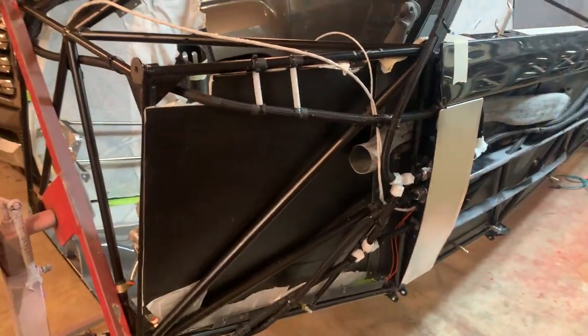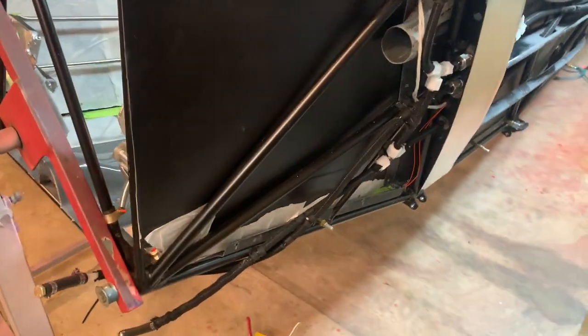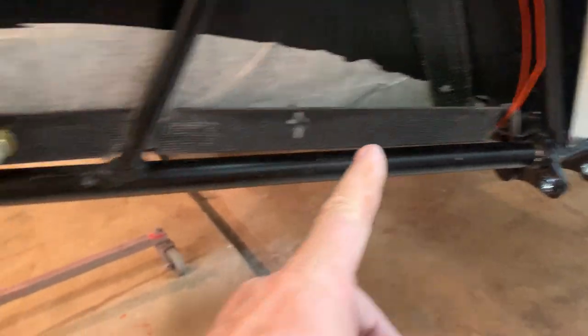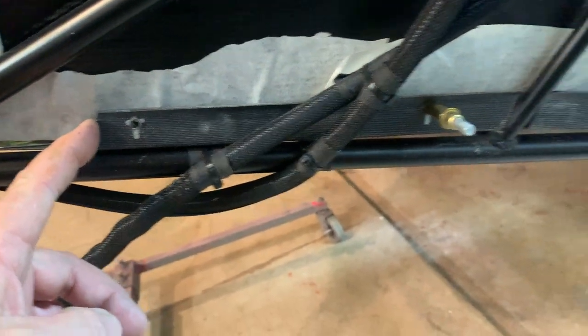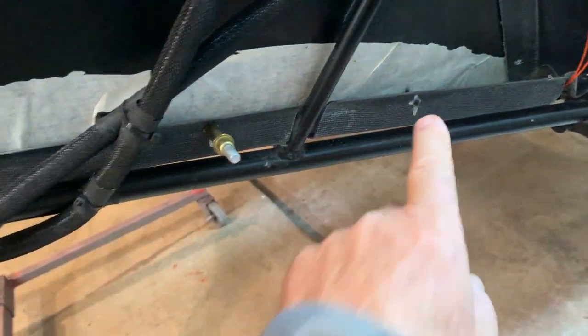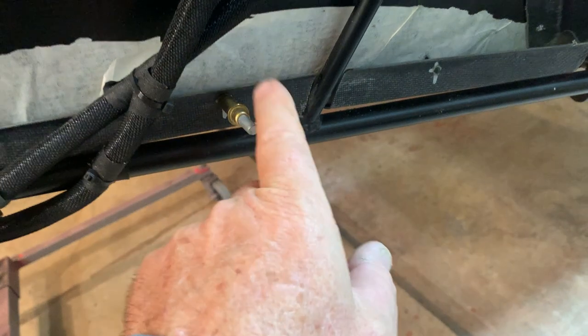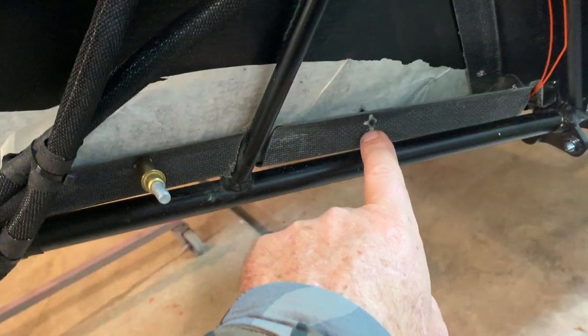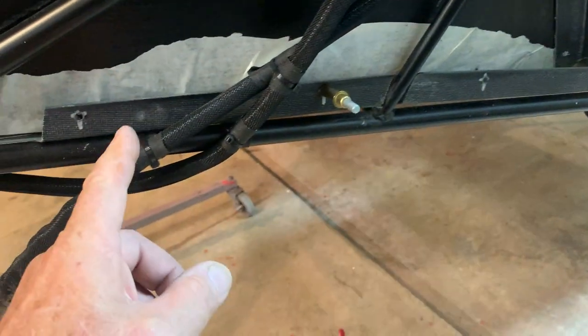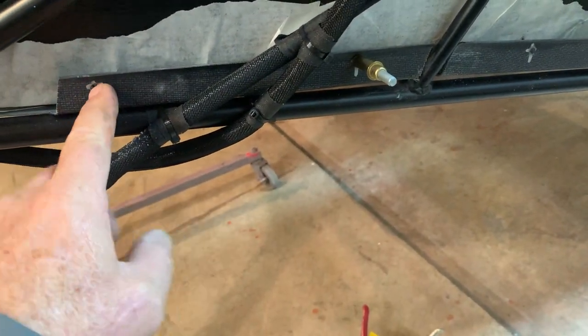I look at the manual and I'll kind of see, well, in this section here, I got a section here, and the manual doesn't really show these cutouts, but that floorboard stops here and it goes to here. Now look in the manual, they call out for three. I've already pulled the Clecos out, but they were in there as I went. I put one out every time, but see there, here, and here. So I put three in. I just put one at a nice distance off of there.